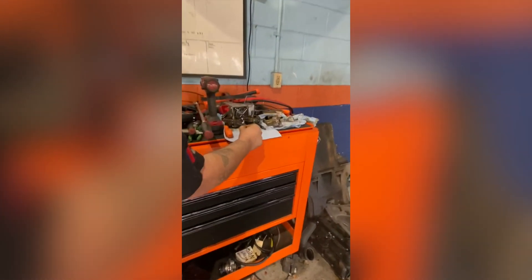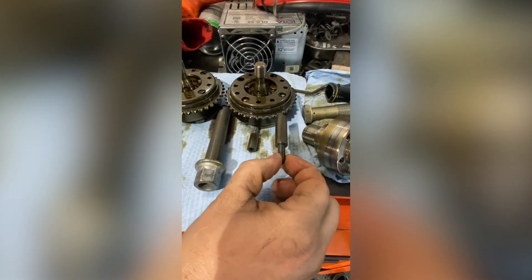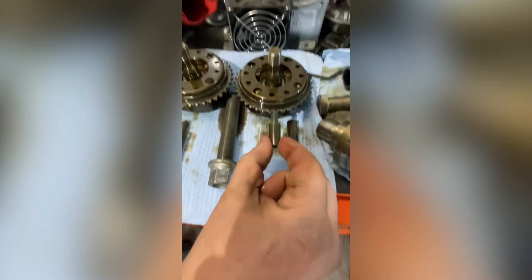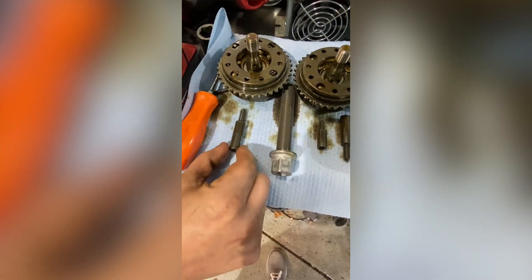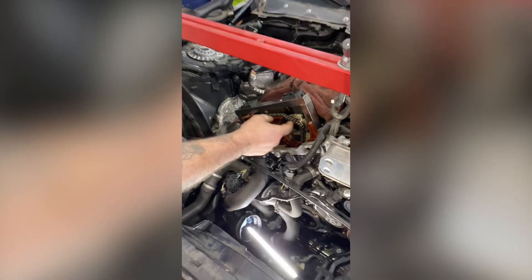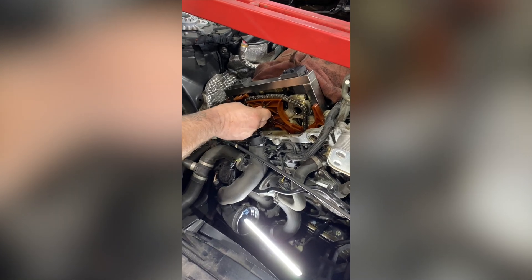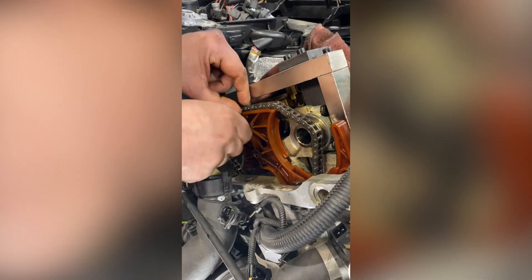Come over here and check out the pins that I have removed — this is what they look like. This is the driver's side lower, driver's side upper, and passenger side lower. We have the vanos units removed, we have the dowels removed, and basically this is the last bolt holding this piece in — then we're going to unbolt this and pull the cassette and chain out.